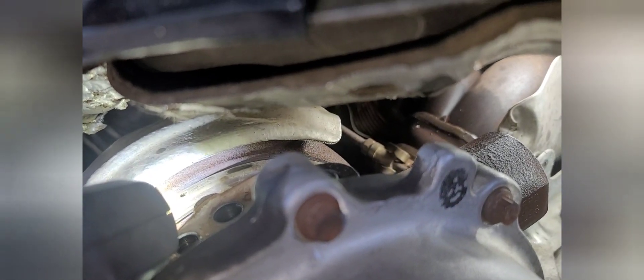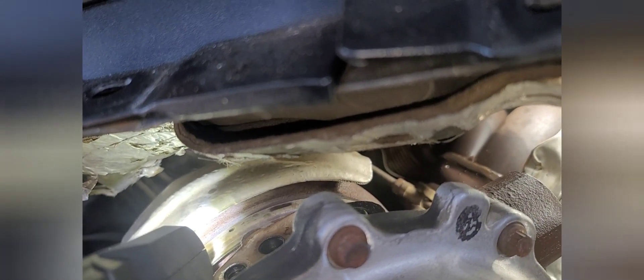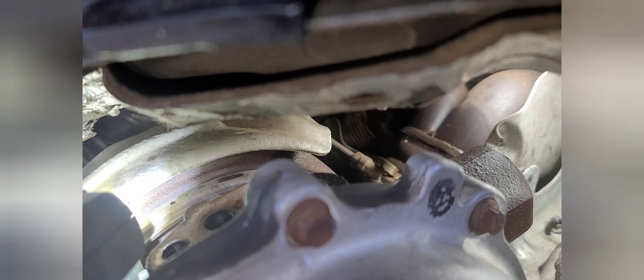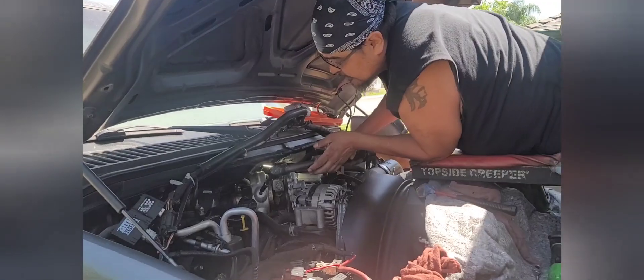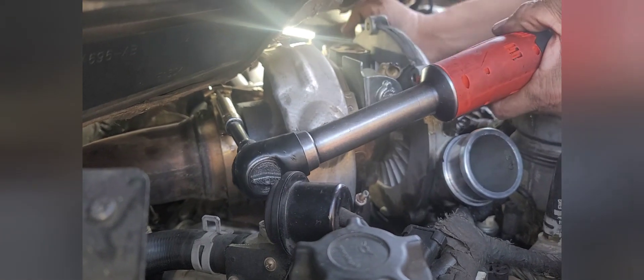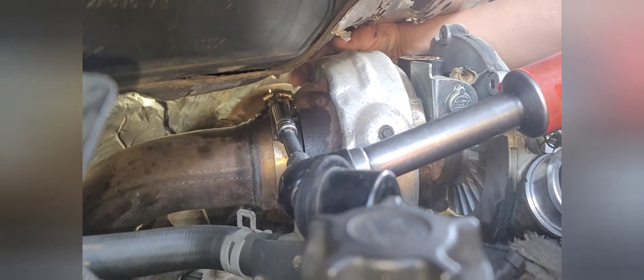It's an 11mm — I'm going to get my ratchet back there and take it off with an electric ratchet. When you get these clamps off, tap on them with a little hammer, you've got some WD-40 on them and it'll break them loose. Now I'm going to take this other clamp off. This clamp we're replacing because it was over-tightened in the past. You can see the bend forming — it's supposed to be flat like the new one. When you put them back on, don't over-tighten them.